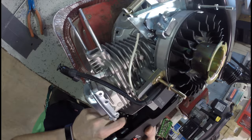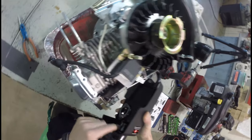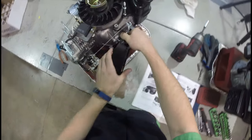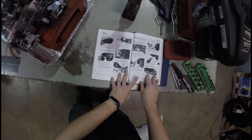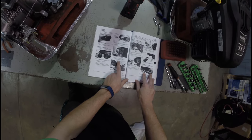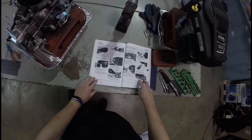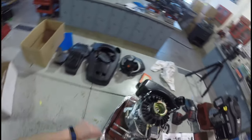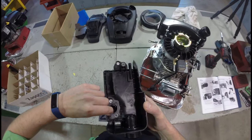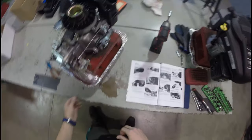Pulling this away gently. We've got two items — we've got this fuel priming pump that I have to be careful of. That you're going to take off just like that. This one slides off fairly easy. Air intake cleaner box assembly — removed. Wonderful. Detach the breather hose from the crankcase — did that. Move the air cleaner base and detach the primer hose from the carburetor. Remove the air cleaner base gasket from the carburetor — that gasket right here. I'm not going to play with it too much because it's a bit brittle, so I'm just going to leave it on there so we can reuse it.